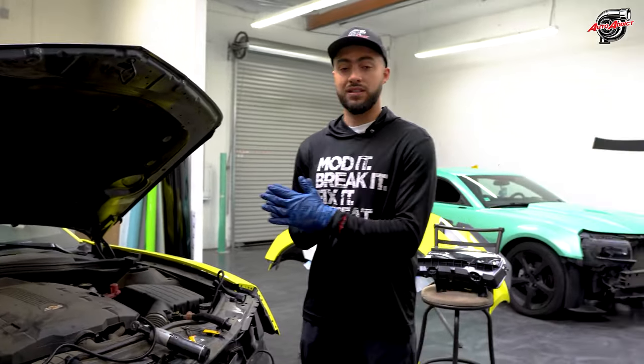So as you can see, for every socket that we make for you guys, the orange and blue rubber socket is going to go to your OEM harness, right? Now, with that being said, we mark a black Sharpie line indicating which is the negative ground versus the positive. This is very, very important, guys, because if we install this the wrong way, you will blow the fuse box every single time, and you have to keep replacing it, replacing it, not knowing why the fuses are blowing on your vehicle.